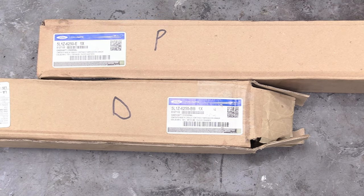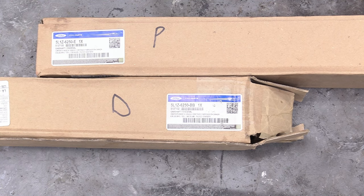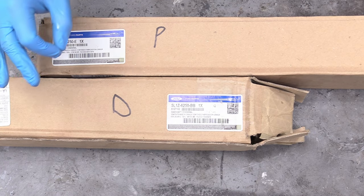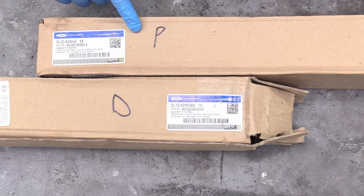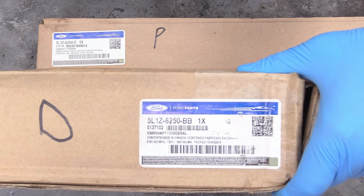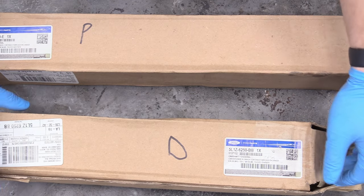There is basically no way to get original Ford camshafts on the internet — I literally looked everywhere and couldn't find anything. I actually resorted to going to my local Ford dealer to get the original camshafts, because it's really important that they are exactly correct. They are a little on the pricey side — I think each one was like $370 and you need two of them. They're different driver to passenger, and I've labeled them as such. I can't leave a link in the description because I got these straight from my local Ford dealer, but they were easy enough to find and I got them the next day.